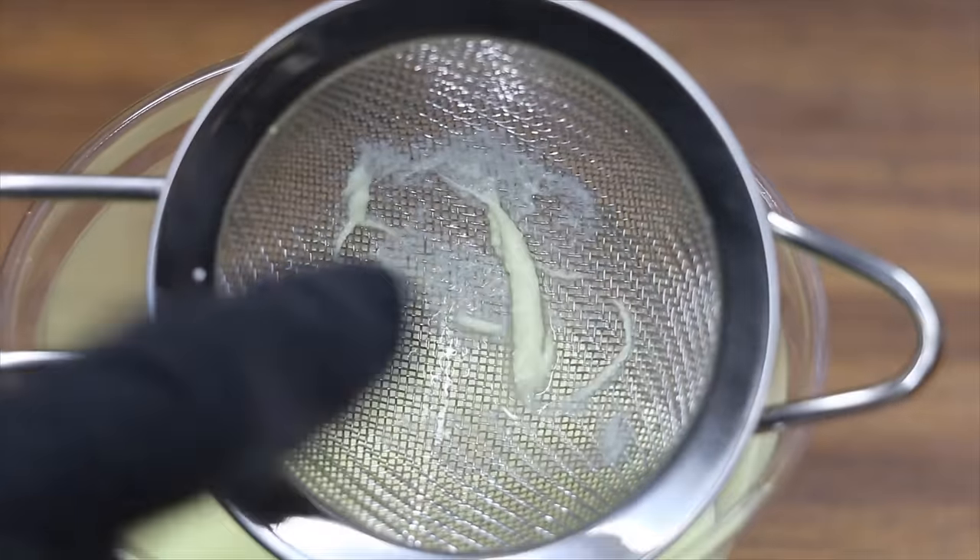After removing the nails from the test cups and rinsing with water: none of these products appear to have removed any rust. There's no visible damage to the zinc coating on any of the washers, and none caused damage to the aluminum. Our control, exposed only to air, also shows no visible rust. No visible corrosion with Tire Slime — you can see the black specks, but that's normal. There does not appear to be any visible rust with Fix-A-Flat either. No visible rust with Multi-Seal, though it is drying out in some areas.